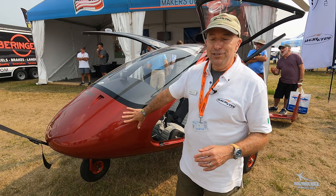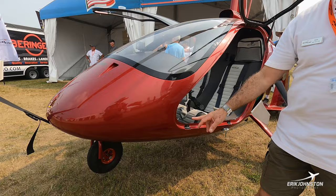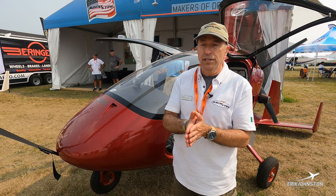I'm going to start here because my hand's on it. The body of this gyro is fiberglass composite — the entire body. It's constructed on a steel frame, which I'll show you more from the back. The frame goes all the way from the front wheel, the keel goes all the way to the back, up to the mast, and then back to the tail. It's 4130 chrome moly aircraft grade steel, manufactured in the United States and welded in Italy by a certified welder.